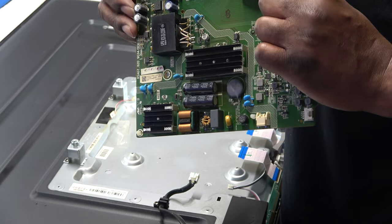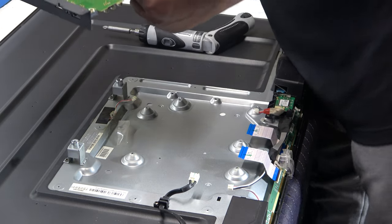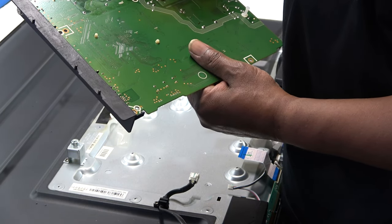1, 2. Okay, and right here is where those capacitors are, okay? Okay, I just want to verify that those capacitors, it looks like these capacitors are on the cold side of the power supply, where it says cold, and it looks like these are the filter capacitors for the B plus for the LEDs. So I'm going to go to the positive side of the capacitors, and these two should be connected in series, I'm sorry, parallel, right? Okay. Both of those caps are connected in parallel.